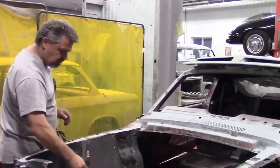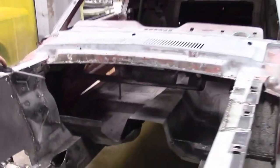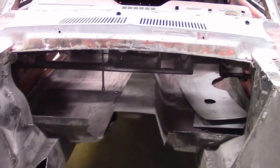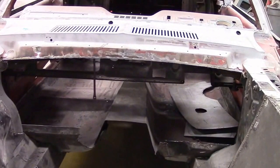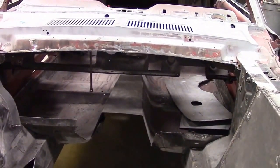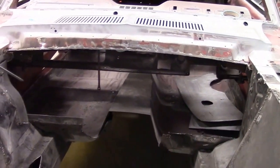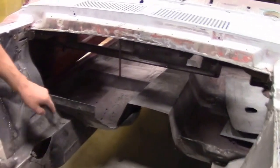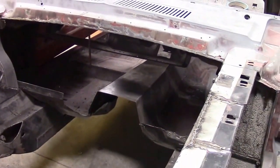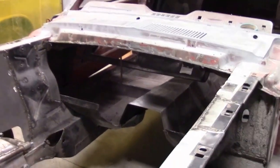So with the suspension all in place, you can see through the front. We've totally modified the front tunnel, and because of structural strength and rigidity, we're using roughly twice the thickness of metal, and we built a custom tunnel, which I'll share with you as we go down the driver's side and look at the view of the inside. So you can see in earlier pictures, we've already done the torque boxes and subframes and so on when it was on the rotisserie. And then we dry fitted the drive line and made a lot of changes and adjustments.